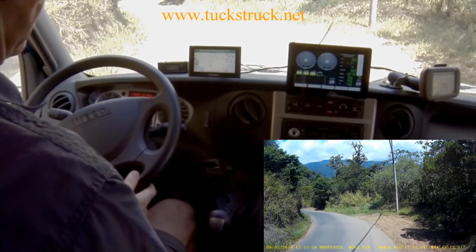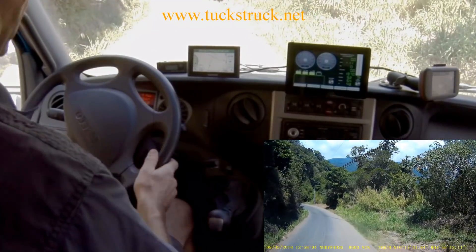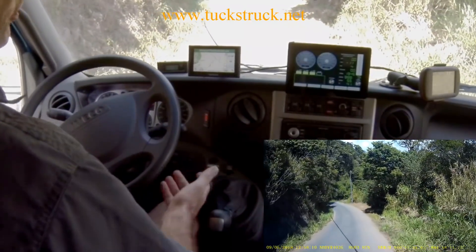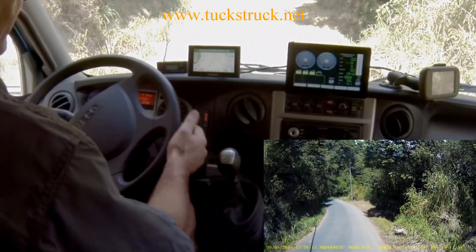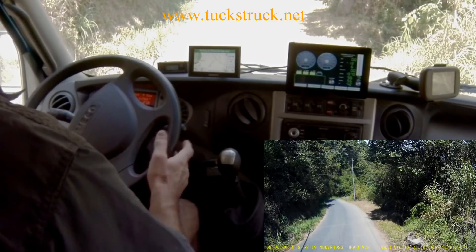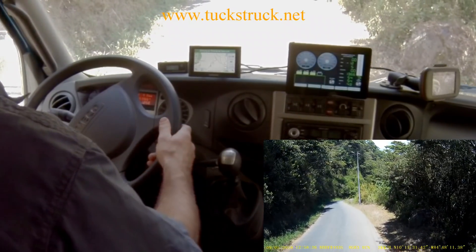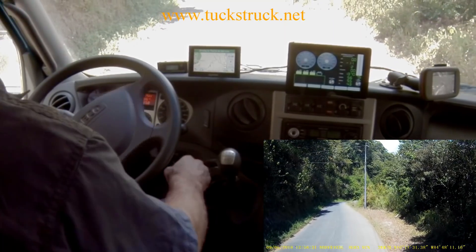As we can see, the engine is just beginning to build up RPM again with no retarder, even though I'm in second gear in low range. I can bring the whole thing back under control again with the retarder to virtually standstill — foot in on the clutch, into first gear, and the vehicle does stop. Now the vehicle is holding on the engine, but I'm down to three kilometres an hour to get the engine to hold it, which would be very painful for any length of distance.